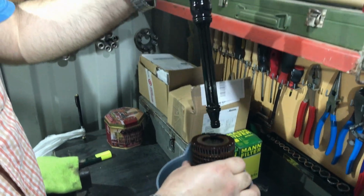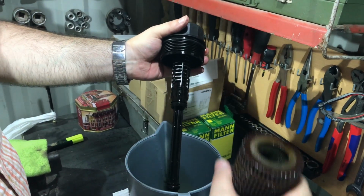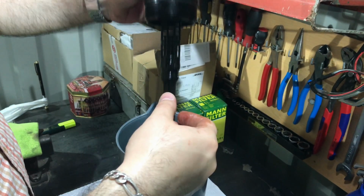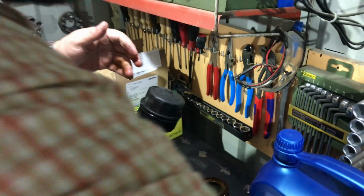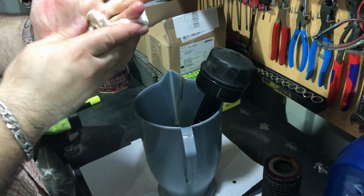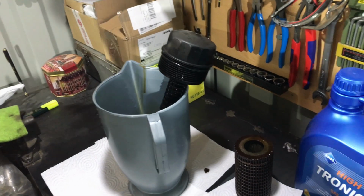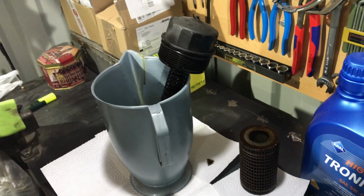It is a good time to also inspect this engine plastic part. I don't know what exactly to call it, so I am calling it the plastic part. Make sure that nothing is broken, everything is tight and good on it. And prepare your O-rings and gaskets to change on this part. You have 4 of them and each of them will come with your engine oil filter complete. The old engine oil filter is ready to throw out. This is garbage now and you will never need it.